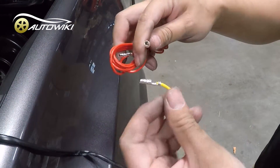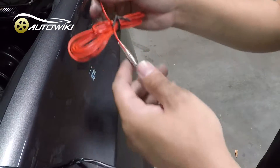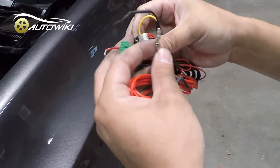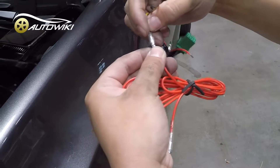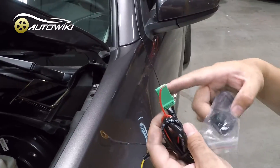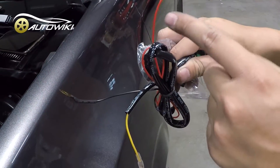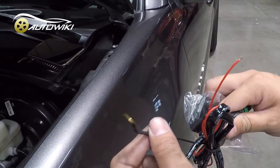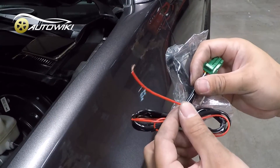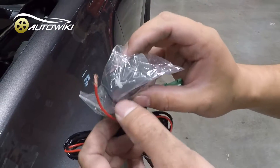The yellow wire might be really short, but here we have an extension red wire — just plug in and this will extend into the cabin through the firewall. This extension cable connects with another yellow connector for the switch wiring right here. The green part just plugs into the switch. The black and red wires — one goes to chassis ground, and this single skinny red wire goes to an accessory power source.